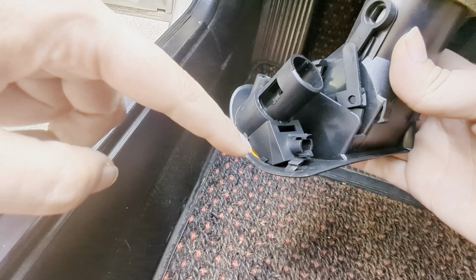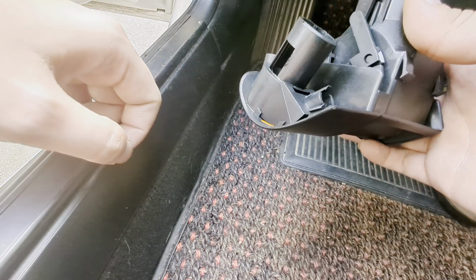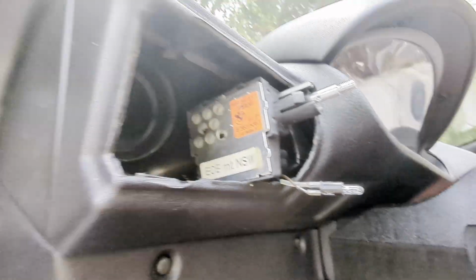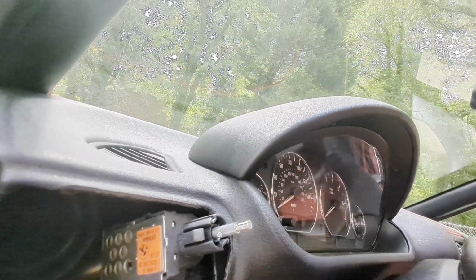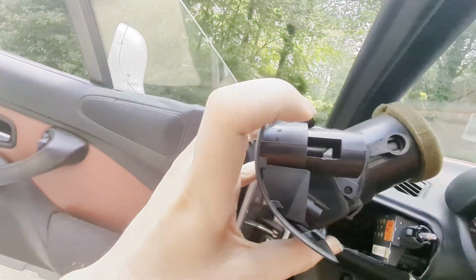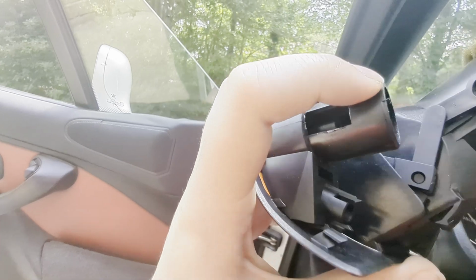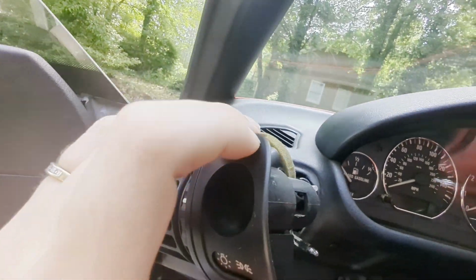And click. And now it's going to hold your little image card in place. And now it's ready to snap the bulb in. But you're not going to be able to get it right away because your actual wiring is going to be too short to reach. So what you want to do is take the actual headlight switch, and go ahead and insert that first back into the cylindrical little space right here, so you can get this close enough. Not all the way.